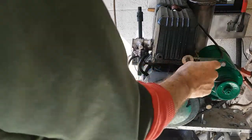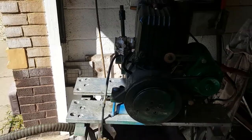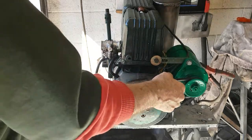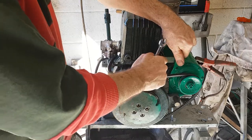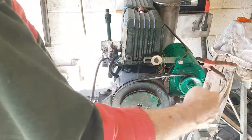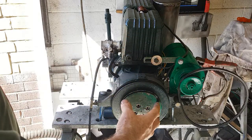The reason this is loose is because I was just demonstrating how to make life easier. If you want to make life easier, loosen or take off the Dynastart belt with a 13mm spanner. You can take the sliding nut off and do it up so that belt is really slack. Then you should find it's not spinning the Dynastart three times faster than the crank like normal. Or you can even take the belt off entirely — that's going to make it easier to pull start the engine.